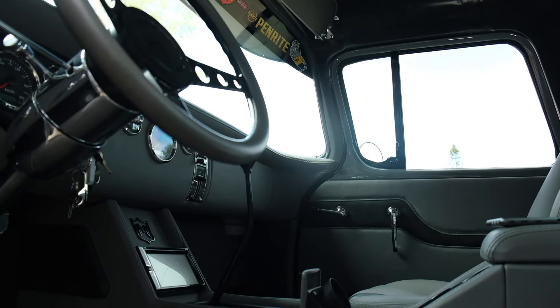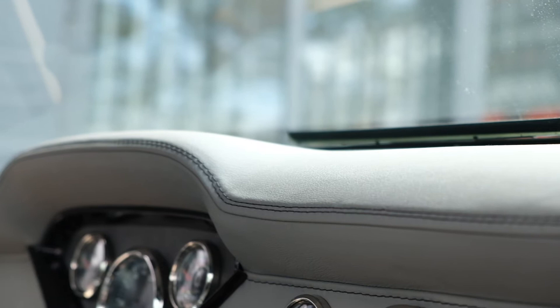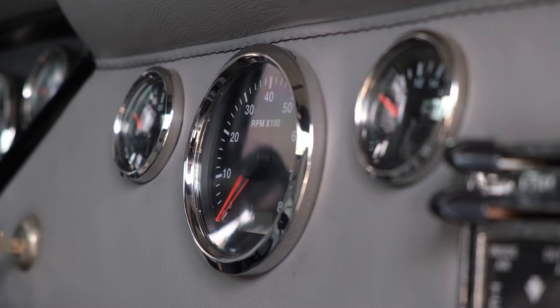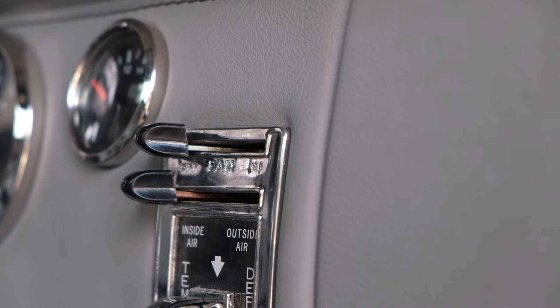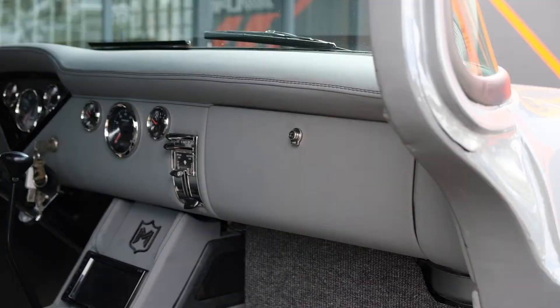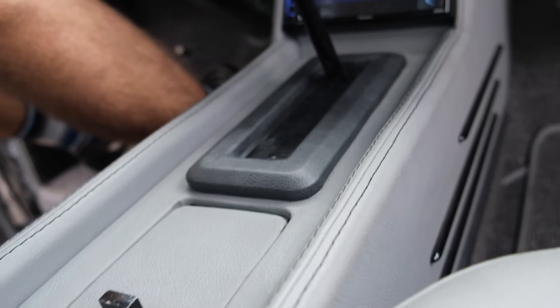Having the simpler panels completed, I moved on to the more testing aspects of the build. I took up the challenge of going a full leather dash for Pete's shop truck and the painstaking process of making that happen. I began fixing gauges, filling holes and smoothing out the foam before I patterned it out in vinyl that would ultimately get transferred to leather, then finally sewn and meticulously worked and glued in place. A rather testing process but I'm glad we decided to run with it. The glove box was covered as well as the dash cluster fascia panel in that gorgeous charcoal distressed leather.